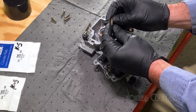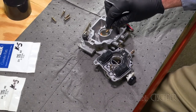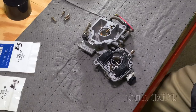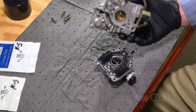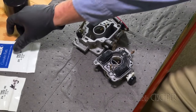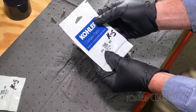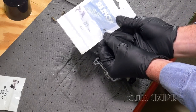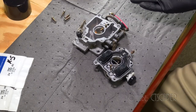And it's probably my fault, or it is my fault, because I soaked that piece in carb cleaner, and I probably screwed up the plastic. And the guy at the shop said usually you remove the gaskets before you douse stuff in carb cleaner. So I got these, by some miracle, he actually had the parts I needed, and these little O-rings, those were $3.15 each.